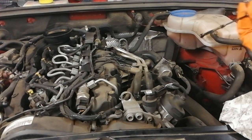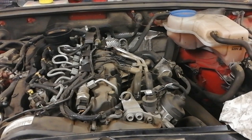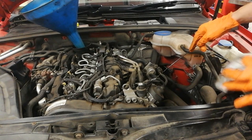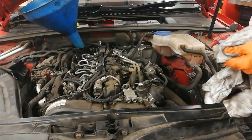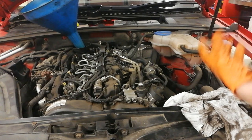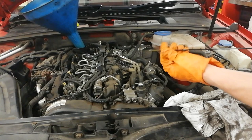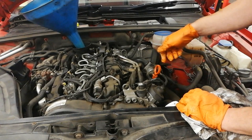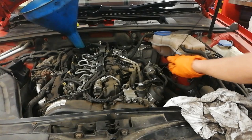We need a wee bit more. It takes very little oil to move up this measurement on the dipstick — so don't be putting another litre in if you see it just at three-quarters. When you do top up, it doesn't take that much to bring it up, but you want to be patient. Wait about 10 minutes for all the oil to drop back into the sump. Also, if you put the dipstick in and pull it out too quickly there's oil in the tube that'll mess up the reading — give it 10 to 20 seconds to let anything fall back down.